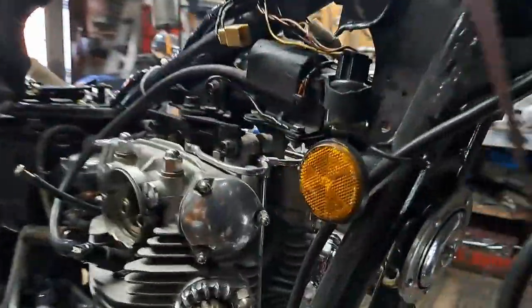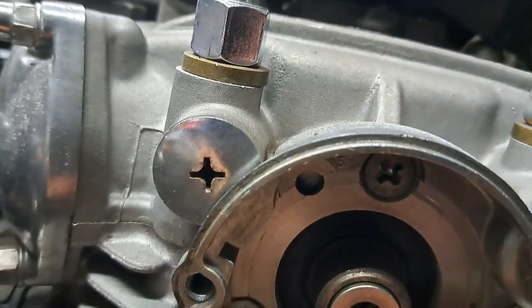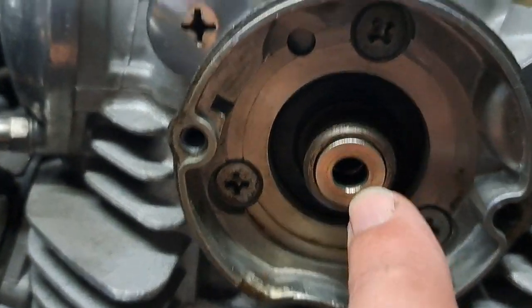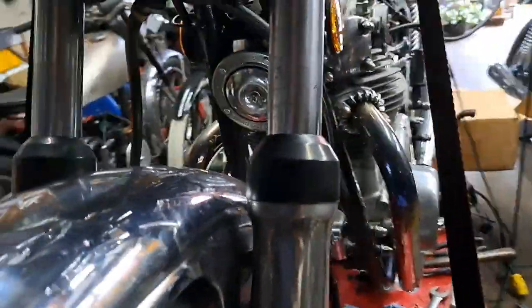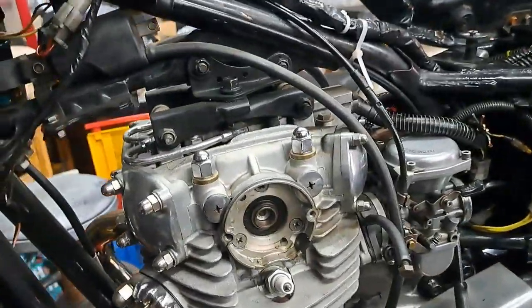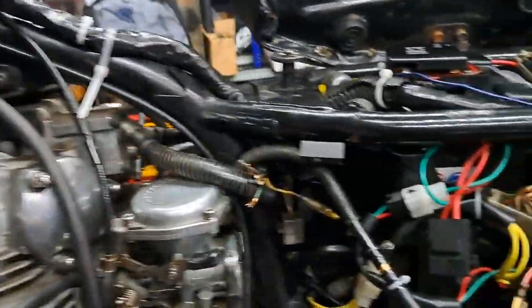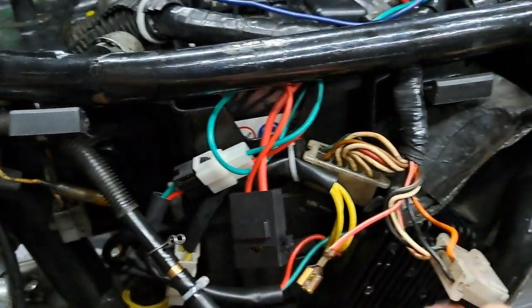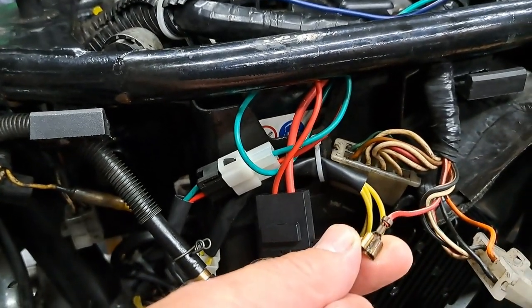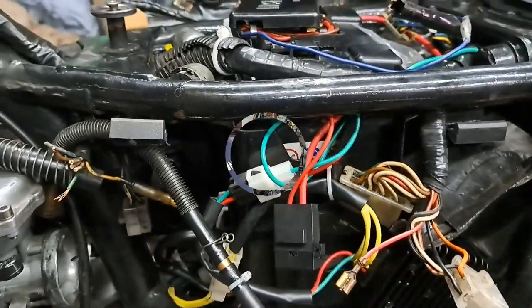There's one on the left side, and over here on the right side this little piece of steel is actually part of the kit, and inside there's a bushing as well. It's all set to go for when Bobby drops by tomorrow. We'll put the ignition unit in place, get her timed up, and see if we can get her running. I've also taken the power wire out of the ignition system plug so that I can use that to connect the Boyer system up.